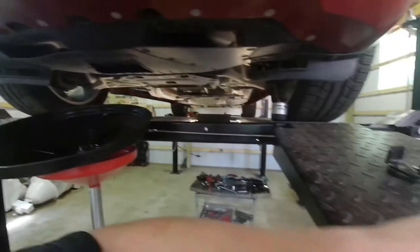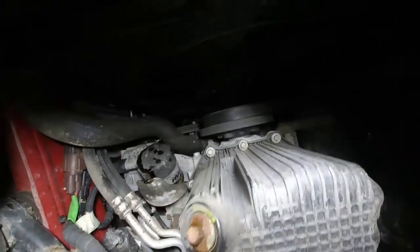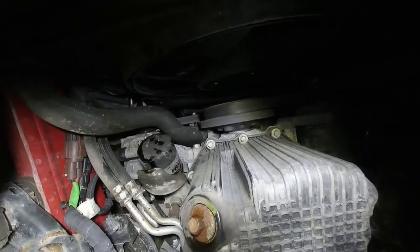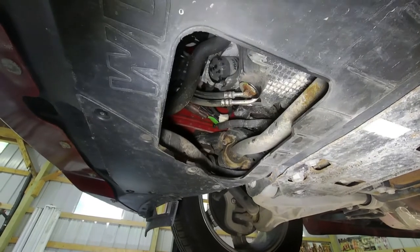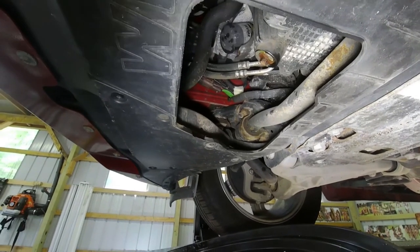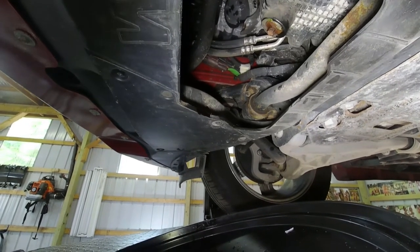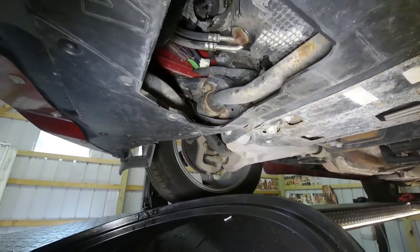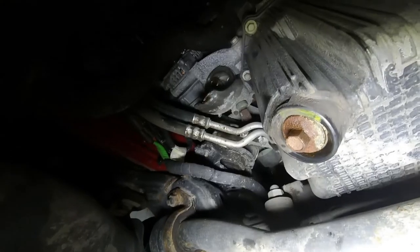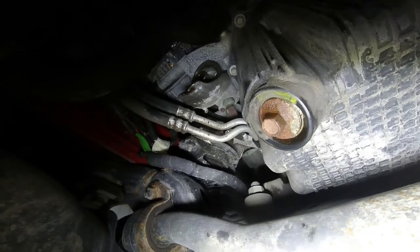It only took about an eighth of a turn with the tool to get it going, and it didn't make as big of a mess as I thought. Once I broke it free, I took the tool off and by hand — it's so high up there — just let it drip down. When it comes to a stop, go ahead and remove it and put it into the tray. The only place where oil got out was right on the edge of the hole. Once it's come to a stop, put your hand up there and remove it — be mindful which way you tip it as it's full of oil. Then with the new one already primed with the gasket wet, put the new one on hand tight, good and tight, and you should be good to go. Got the oil filter out — it's draining — so take a rag up there, clean it all off, and install the new filter hand tight.